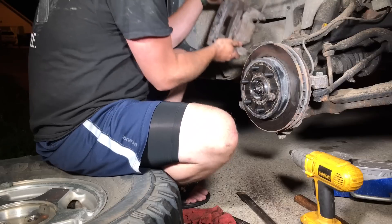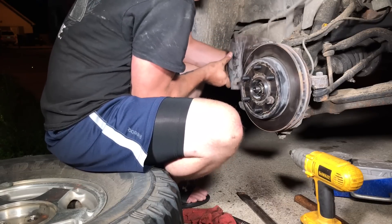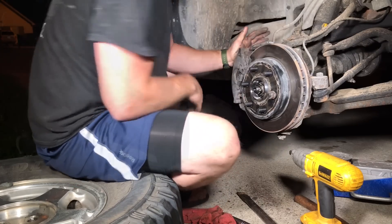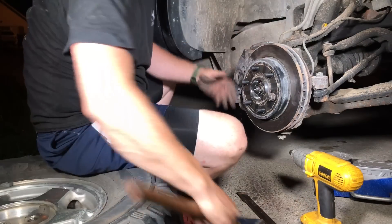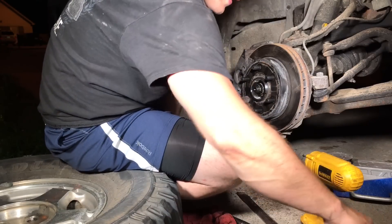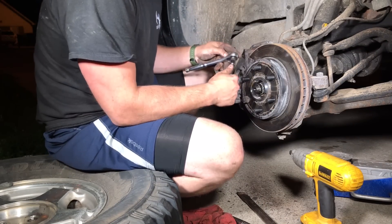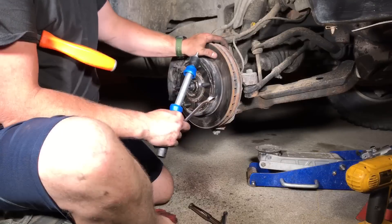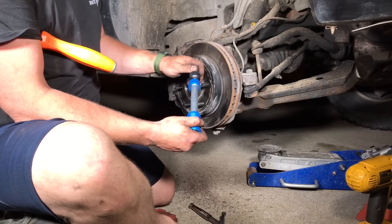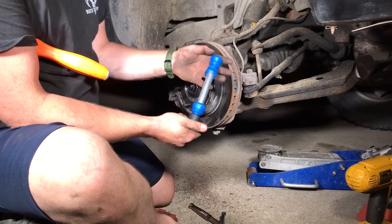You've got to beat it on because of the brake pad. We'll take our 3/8 Allen heads, run our caliper bolts back in, and we'll complete this. Since we're already in here and this video isn't long enough, we're going to go ahead and put new sway bar end links on this side. The other side is actually already broken, which is why we're doing this.